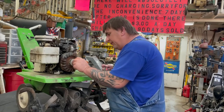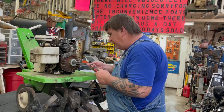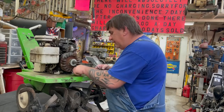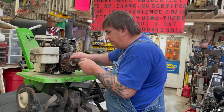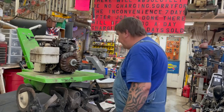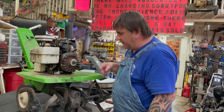We're going to put a new starter clutch on this too — there's a lot of wobble in it. They have special wrenches you can buy to take this off, but I'll show you a simple easy way to take these off without spending money on one of them tools. These are a doggone good motor, the old 5 horsepower Briggs. Make sure you have a chisel — a dull one. You don't want a sharp one, because all you're going to do is chop these tabs right off.